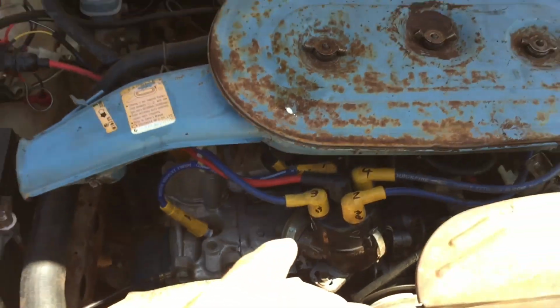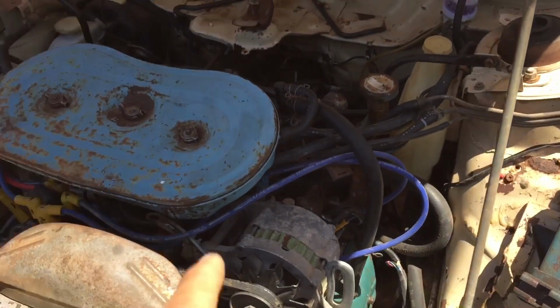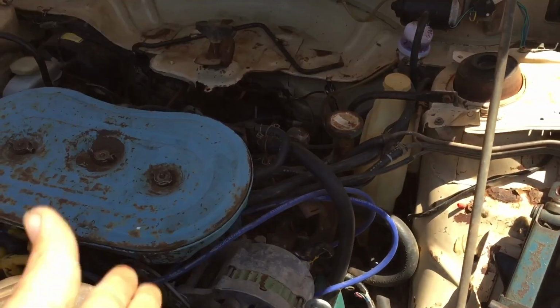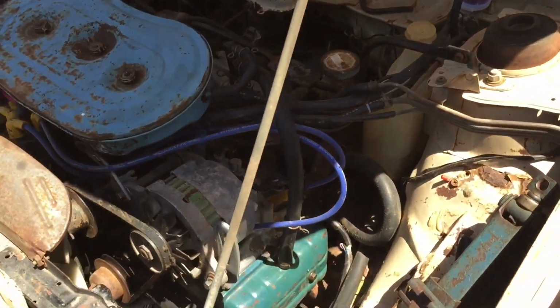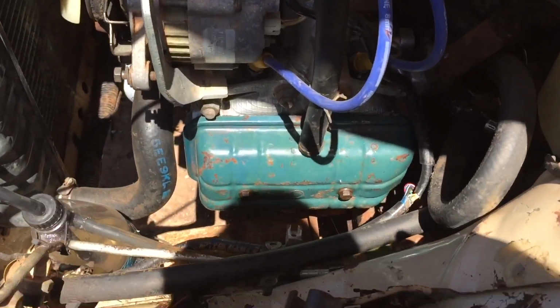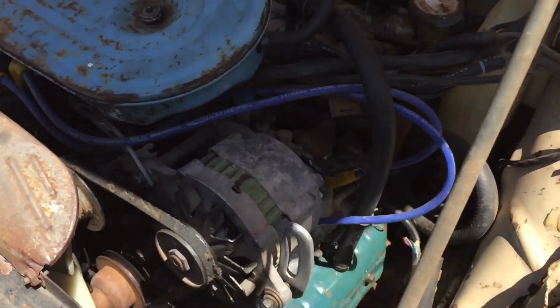This is the EA81 engine, apparently really bulletproof, but this one's kind of noisy. And before you ask, yes, I use 20W50. Can use 20W60, but don't have the money for it. And this is the yard car. So, yep, pretty standard. Definitely was AC because it has all the AC lines and wires and all that.